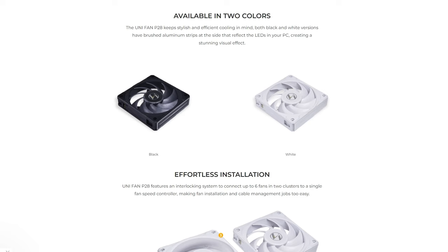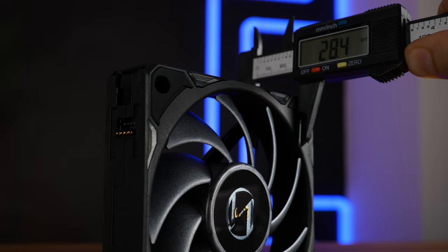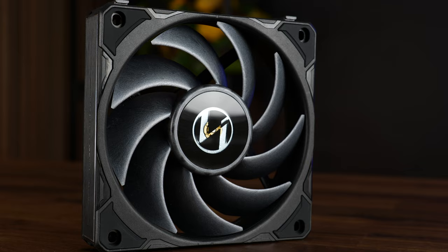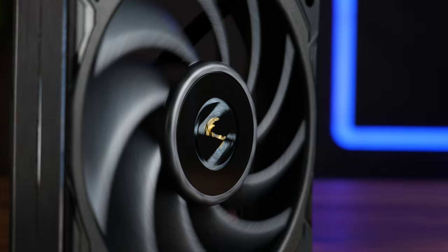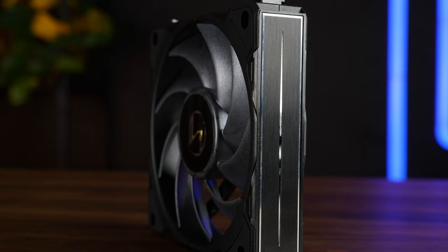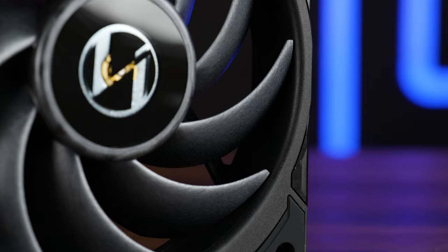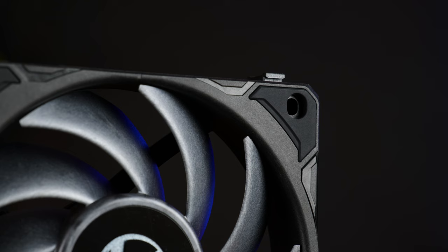With the benchmarks done, let's have a closer look at the fan itself. These new 120mm Uni P28 come in either all black or all white. Measured in their thickness, they are indeed about 28mm thick, though this is mostly due to the rubber. In the center of the fan, Lian Li left a cutout to see the metal bearing while still covering it with a piece of see-through plastic, which is then partially painted with a negative of Lian Li's logo — which unfortunately isn't always 100% precise, leading to some oval-shaped rotation. Made out of LCP or liquid crystal polymer, these nine heavily bent wings can withstand a lot more force than traditionally used plastic, meaning the fan can spin a lot faster without the fan blades straightening up and touching the border.